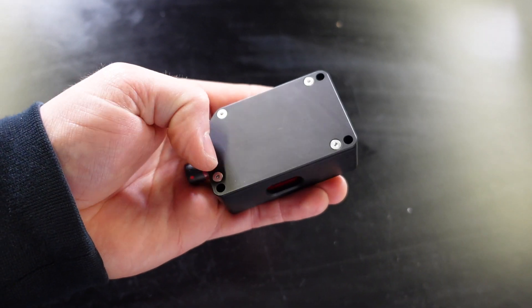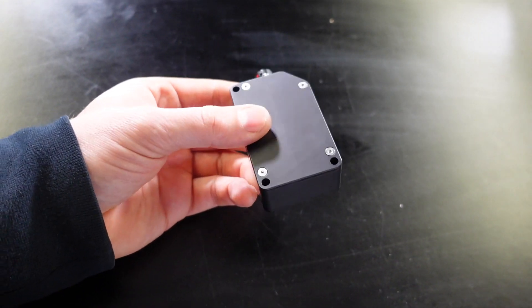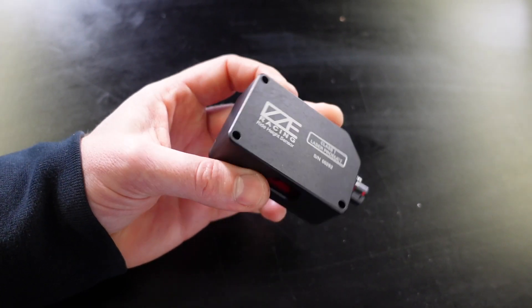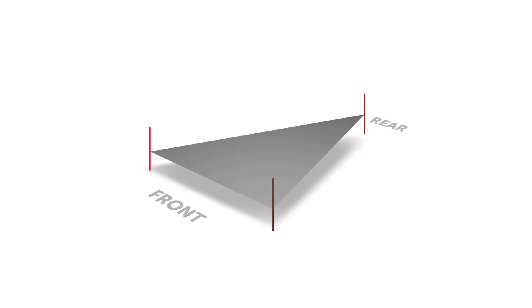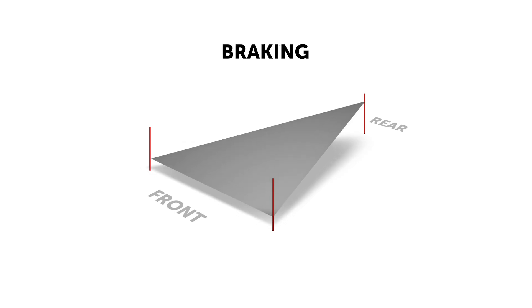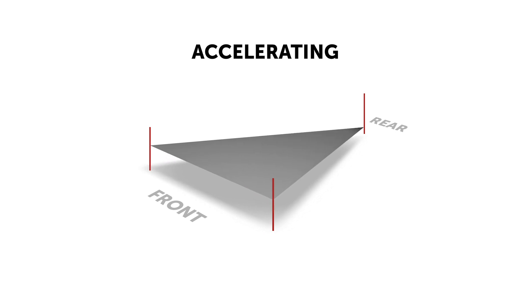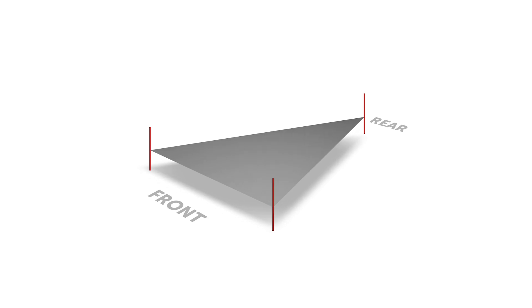Typically you would want to have this rigidly mounted to the car, though manufacturers recommend isolating it from vibration in high-vibration locations to avoid measurement problems. You would typically have three of these sensors mounted to the car. Because you can treat the chassis as a plane, three measurement points completely define its inclination and height. The most common layout is two laser ride height sensors at the front and one at the rear, since the front of the car tends to be more sensitive to ride height. The two front sensors should be as far outboard and as far forward as possible, with the rear one mounted centrally towards the rear.